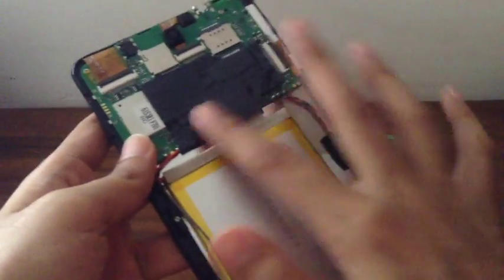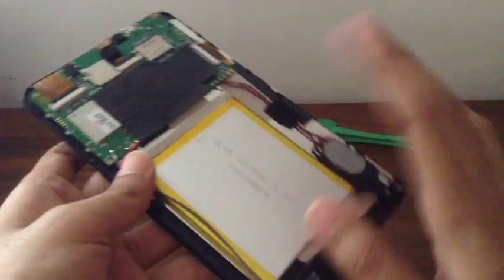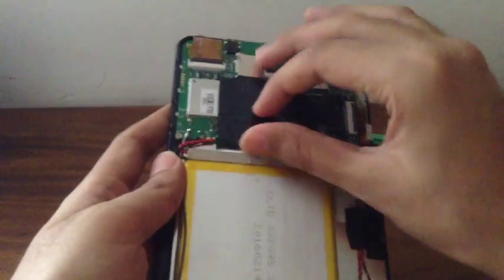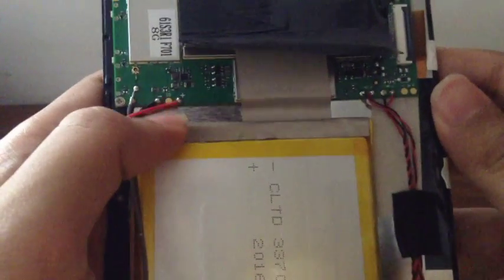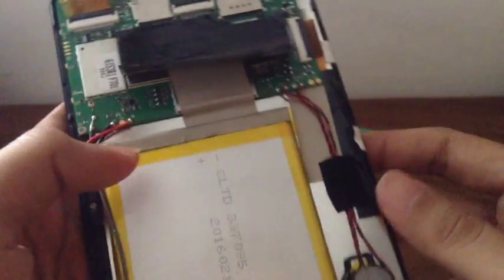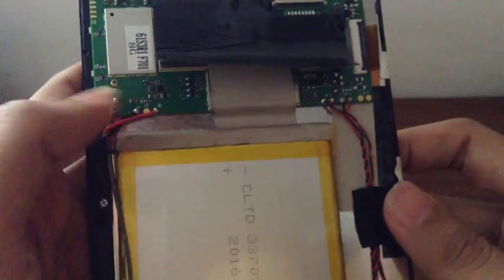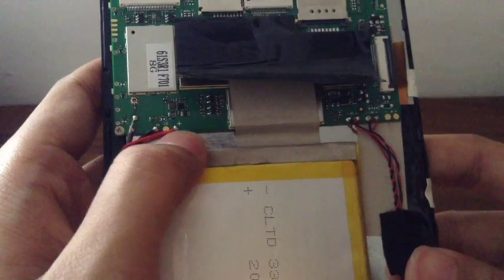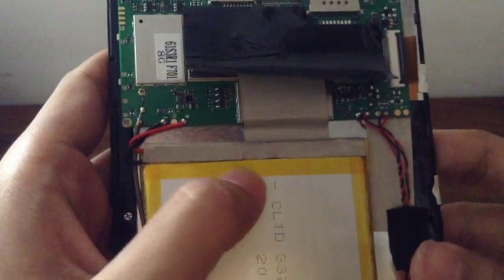Once you've disassembled your device, it will look quite different from mine. In my tablet, the circuit board is up here, the processors and all are under the heat shield, the battery is over here, and there are speakers and so on — quite a minimalistic device for the price. What you're going to do next is search for the positive and negative connectors of the battery, which are usually around the top and bottom. Mine are marked, but on some logic boards they may not be marked, so take a photo to remember which is which, because you can short out the circuit if you solder them the wrong way around. Plus is red, minus is black.